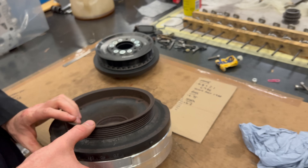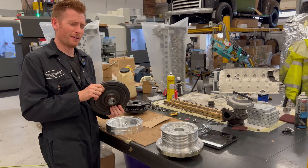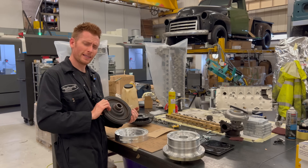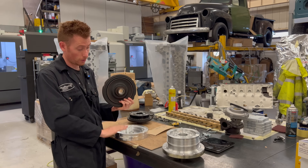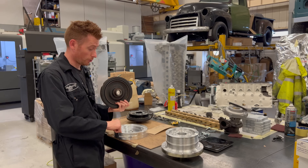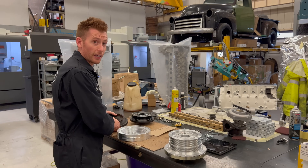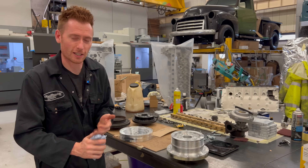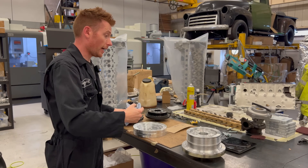Rather than having to buy a new pulley — I think the original Mercedes ones were about £500 and they're not available anymore — I've got a feeling the common rail pulley will fit, but they don't have any markings. Something like this tool would be very useful to turn common rail pulleys into 606 pulleys. That's an idea for anyone at home making notes on how to build a 606 business.